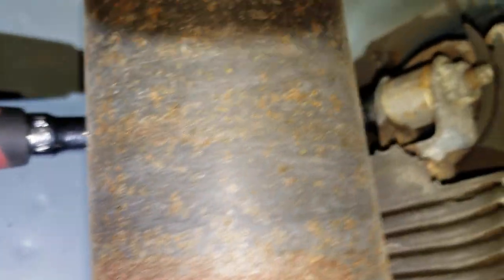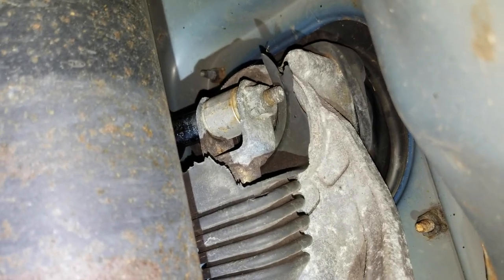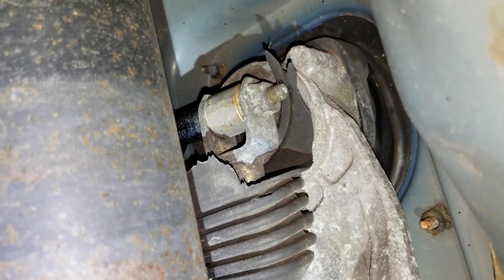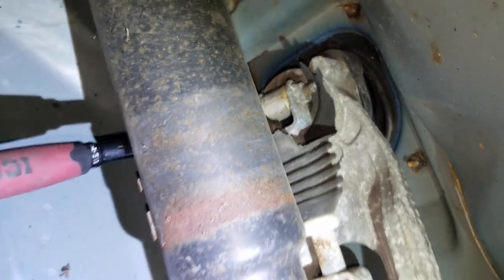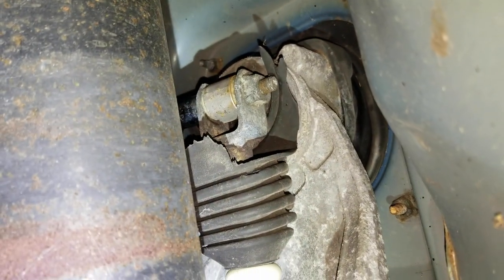The install is pretty simple. You will have to get the car up on jack stands or ramps because there is one bolt that connects the shifter to the shifter linkage underneath the car. Once you're underneath, there's a bolt at the very bottom of the shifter that we need to remove — it's a 12 millimeter. I have my ratchet on there and once you get that bolt off we'll be able to go inside the car and remove the shifter.